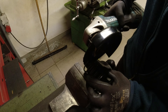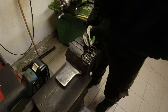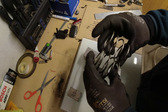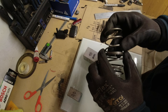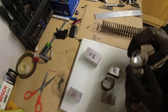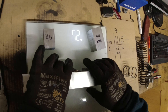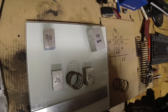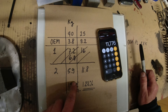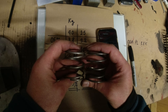I cut the shaft off with the angle grinder. I'm going to bend this first leg down a little bit. Old and new spring side by side — the new one is slightly longer, same diameter. The wire size on the old one is 3 millimeters; on the new one it's 3.2 millimeters. In the working position the new spring reads 11.5 kg — that's 3 kg more to open it fully, about 50% more in the range where the valve was opening prematurely.